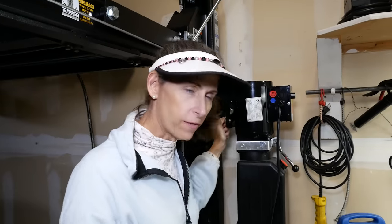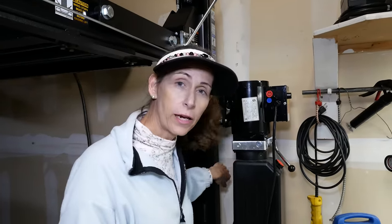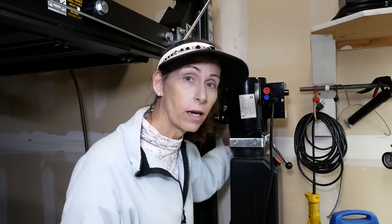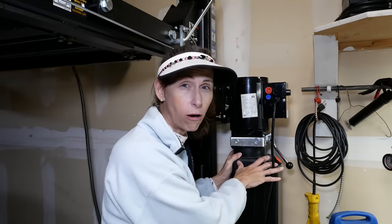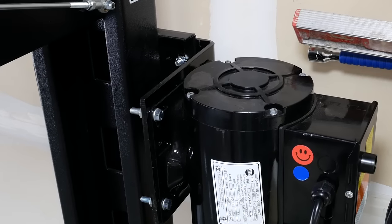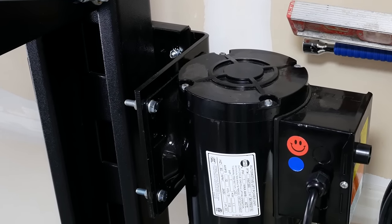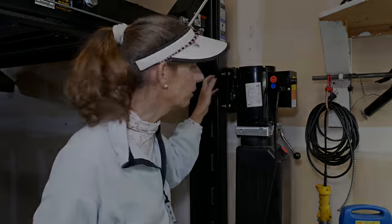When we got our third lift, we had a small problem — there's not enough clearance between the side of the lift and the wall here. I was thinking I'd just have to put the power unit on the wall, but it turns out that Direct Lift actually makes a really cool bracket to mount it on the front of the lift. That's going to be our Top Tip number three for getting the most out of your lift.